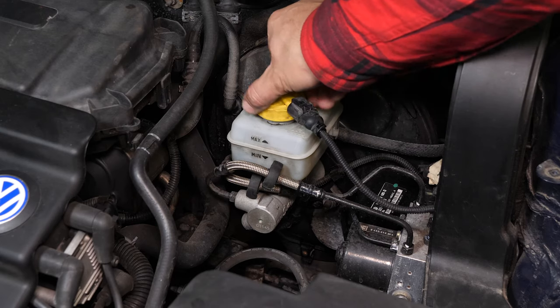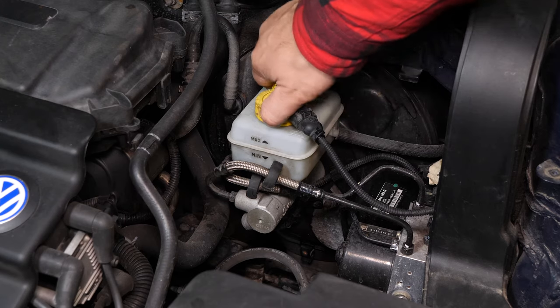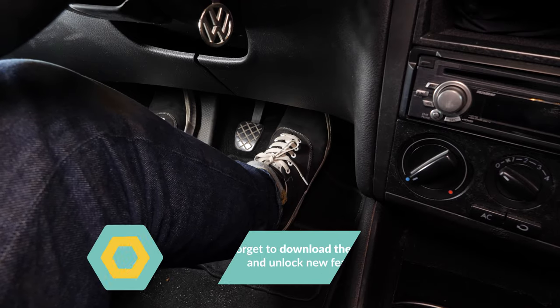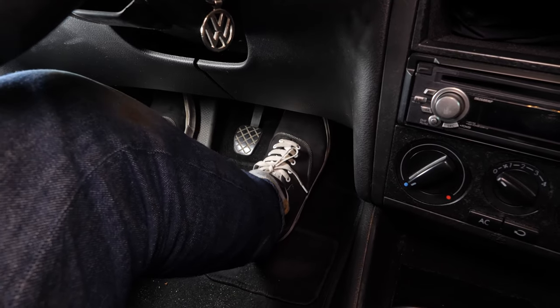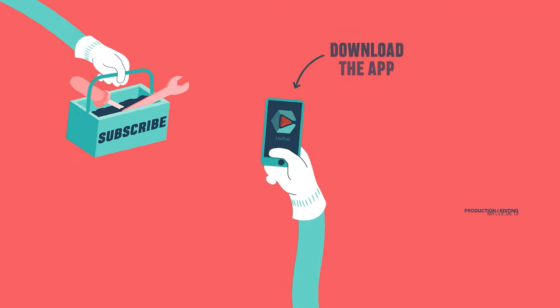Before starting your car, don't forget to screw the brake fluid stopper back in. Be careful — before using your vehicle again, start your car and pump the brake pedal a few times to bring the brake pads together again. Try to drive smoothly and avoid sudden braking for the first 50 km or so to avoid glazing the new pads. Operation completed.